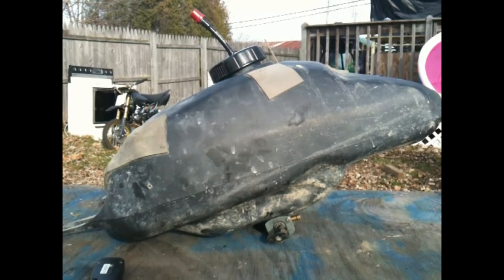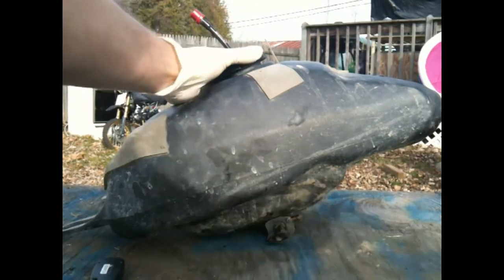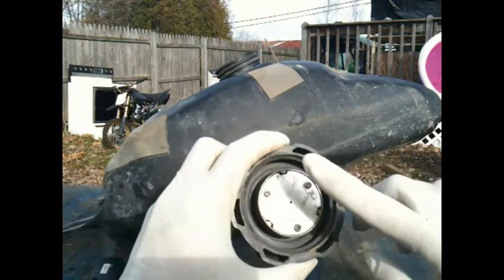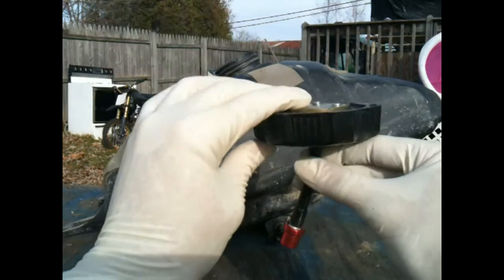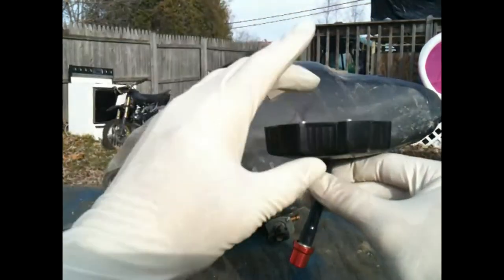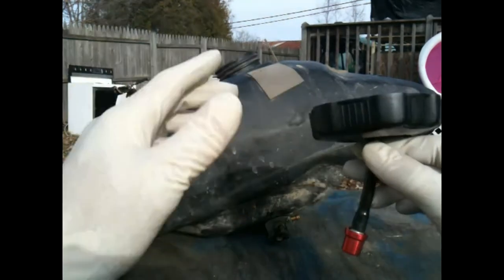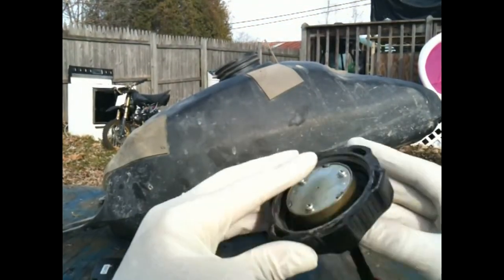This is usually caused by lack of fuel. There are two possible causes I'm going to show you here today. The causes are either the gas cap vent — the ball inside that seals the tank from leaking when your four-wheeler flips upside down — could be stuck in the closed position.